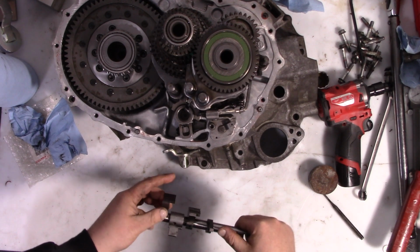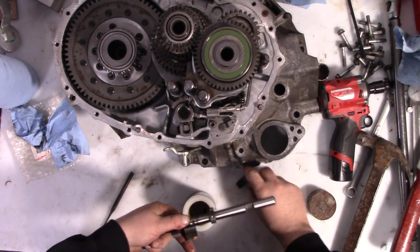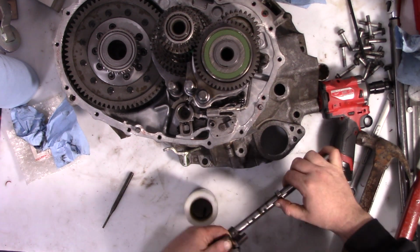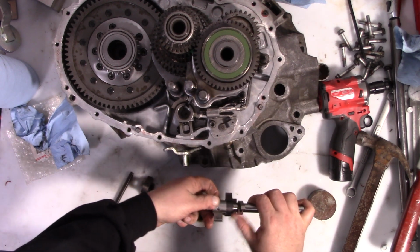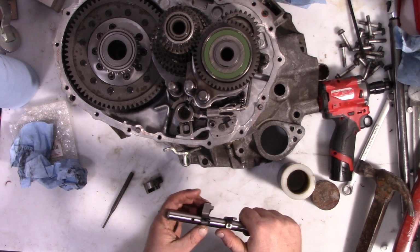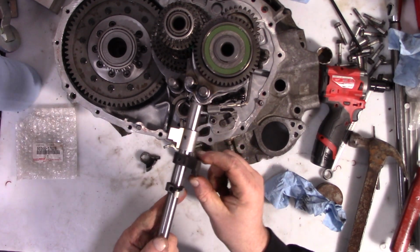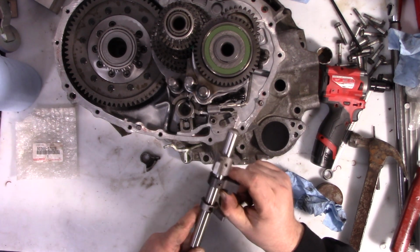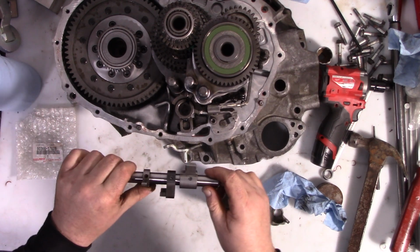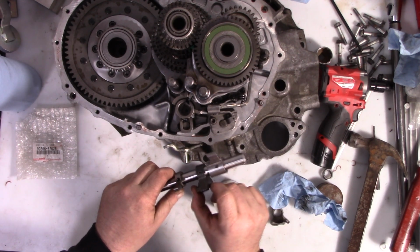So this is pretty easy. We just got to pull one of these sides off and then the middle, and then put this in its place. Gonna slip that off and put it on in the same direction. Actually, it's going to be easier if we start the pins on the bench. All right, and note, the new part you're putting on there does have a tiny bit of play. I would have loved to make it just as tight as this one, but the truth is, it doesn't actually matter. That doesn't affect the functionality, and I also don't have access to what the tolerance on this shaft is, so I didn't want to make it to where they didn't fit. So, it just wobbles a little bit. It's not a big deal.